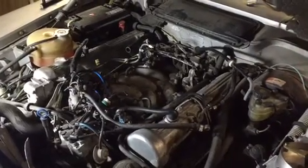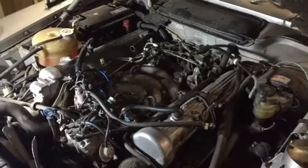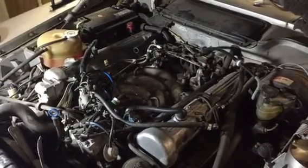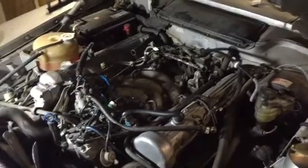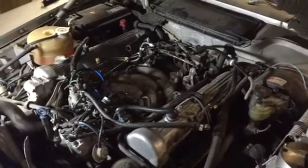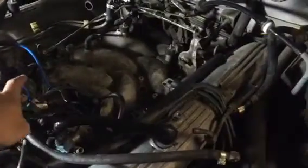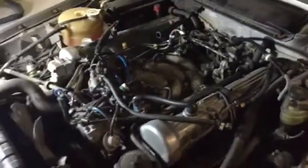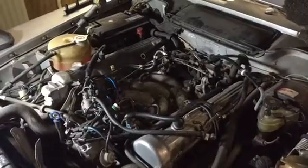I have a couple of movies on high idle issues within the Mercedes community, especially the M117 which is on the late model SL, S-Class, and SEC. They have high idle problems and most of those are due to three components: either the idle control module or the idle valve. I have a fix for this on YouTube — it's two films, take a look at it.